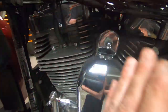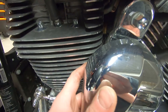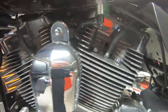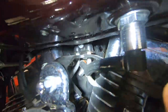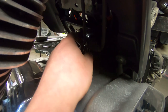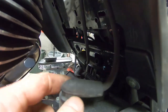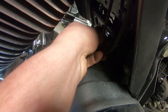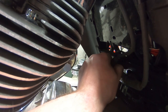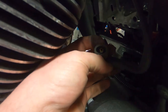We want to look at the horn and make sure it's in a good position. Sometimes if somebody changes or moves it, the bracket can hit up against the cylinder head and the wiring can dangle down and get caught on everything, and can start wearing through. You want to look at the fuel lines and make sure you're looking around for oil leaks. You want to make sure that both spark plug wires are on tight. That one was loose. So we want to pull it off and make sure it's not full of water and corrosion. I've had that happen a lot on Milwaukee-Eights that have four spark plugs - I touch it and go "oh, that was loose," and then pull it off and find water in it, corroded the spark plug wire.